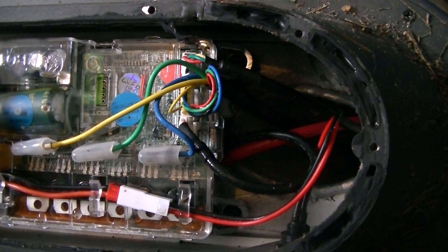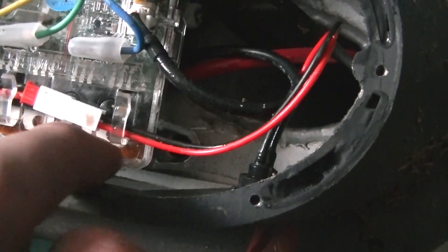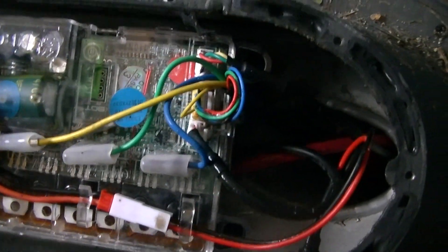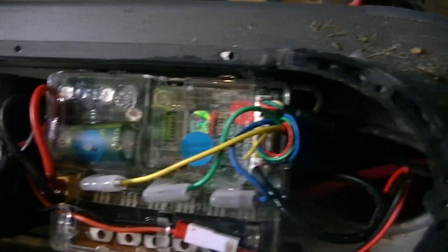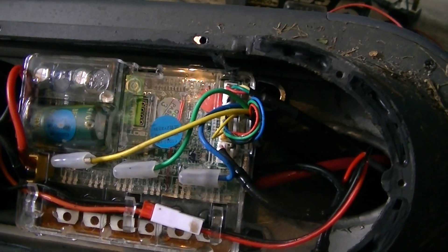That concludes this video of the little electric scooter — well, no it doesn't. Here's the battery. It's a Sanyo battery, it's pretty big, it takes up the whole space, and it obviously has a hub motor in the front. This is only meant to be a teardown. You can see — I don't know how many FETs we've got — one, two, three, four, five, six. Six FET controller, which is pretty standard. It does look like you could put a bigger electric bike controller inside here — I could put a 1000W controller in here and a couple of 6S LiPos. Maybe we're not returning it. Maybe we're going to do that. I'll see. That concludes this video. See you later. Bye-bye.